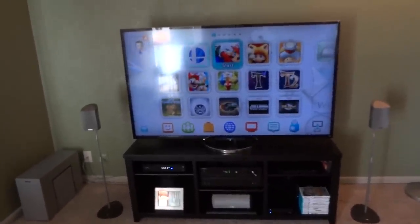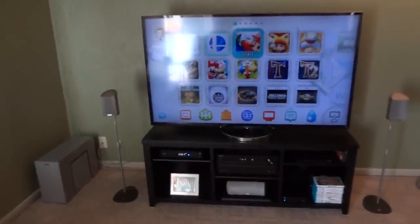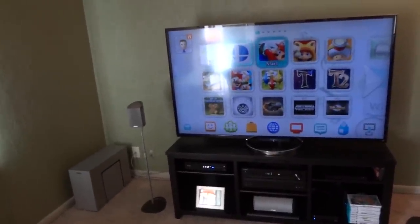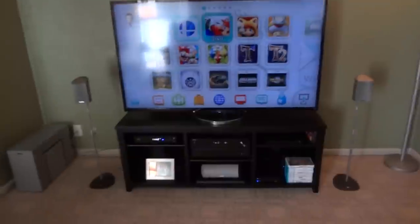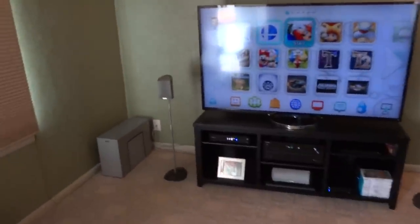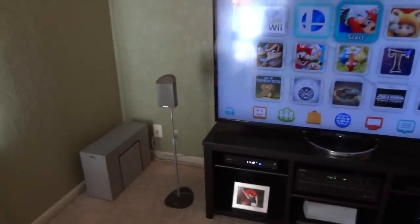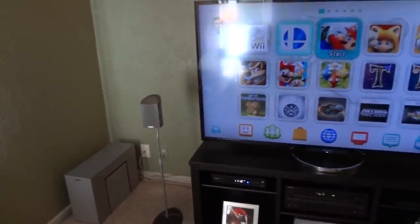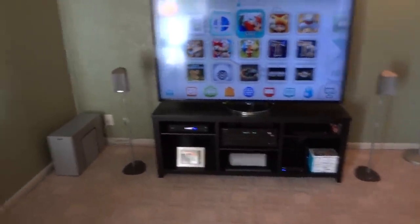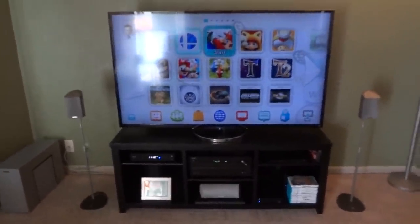Polk Audio is what I always get, but they're towards the mid to high end. I picked these up open box for $200 for the whole set — they were $799 brand new about five or six years ago, so I got a great deal. Get yourself any decent 5.1 set, but make sure it has a subwoofer with at least an 8 or 10-inch woofer with above 100 watts. If you have a big living room you'll need that — don't get any of those six-inch woofers with 30 or 40 watts, it's just not going to cut it.